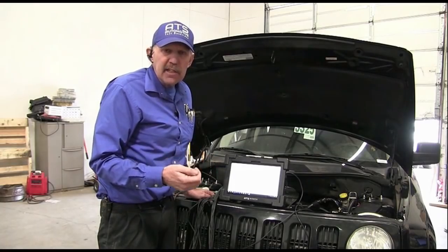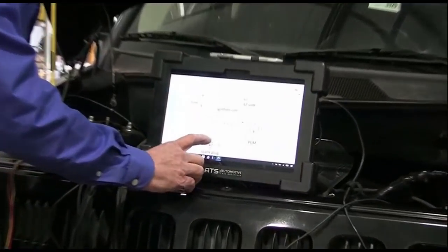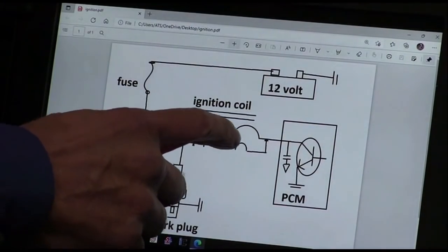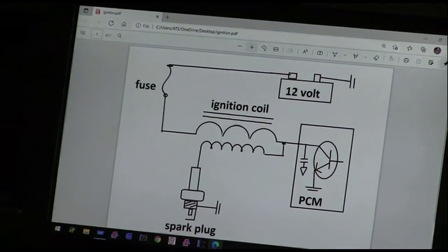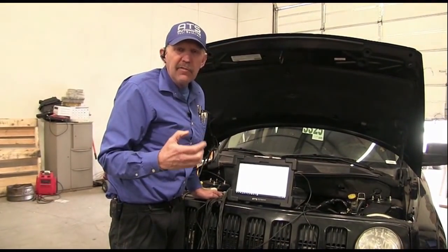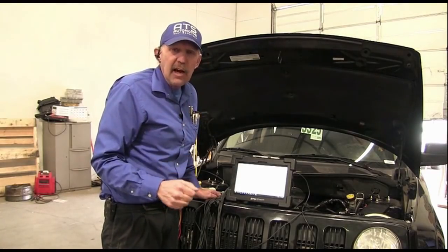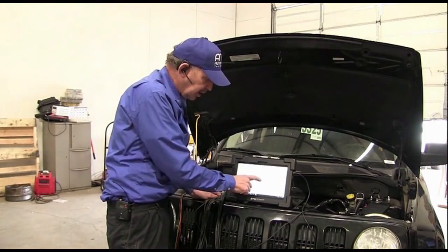Now this one isn't exactly leaking. But what happens is, since I have a large potential that's in the negative leg, now wherever the energy was made, which means this winding right here, that energy has to return to what made it. If your electrical energy came out of the battery, it has to return to the battery. If the electrical energy was made by the alternator, it has to return to the alternator. Wherever the energy is made, it has to have a return path or you'll have no current. So I have to return to this coil.